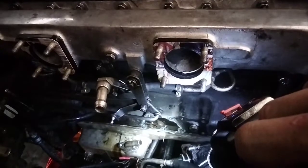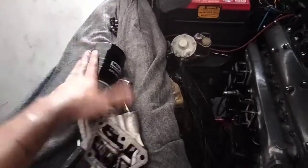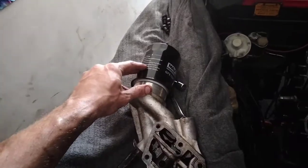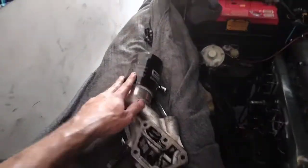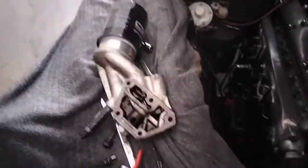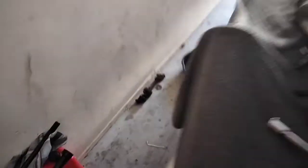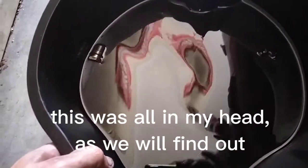Feeling pretty good about it. I'm tossing up whether the oil filter — it's brand new, it's got 500km on it. I replaced it in Sydney thinking maybe it was a blockage in the oil filter — turns out not. What I might do is cut this apart, because if it's 500km old it will tell us how much, if any, metal has been lost from the engine from running at such low oil pressure. Tipping it up on its end — I know all about engine glitter from owning a lot of high-powered motorcycles. It wasn't that bad, but I could tell there were very fine, tiny amounts of metal fragments. Let's see if I can pick it up on camera — maybe there's a chance it's all just in my head.